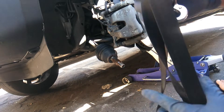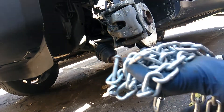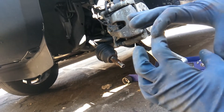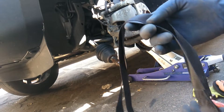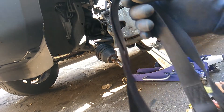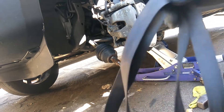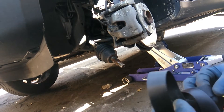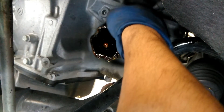The way we're going to take the CV axle off: you can rent a tool, but some spots are more difficult than others. I usually use a chain and a slide hammer — the chain goes around the CV axle — but the space here is so limited I cannot get the chain in. So I'm going to use a strap. I tried with the strap and it already popped out the CV axle outer portion, no biggie, but we still need to get out the inner hub.